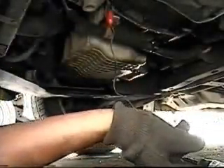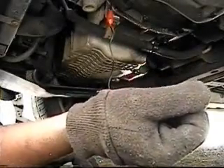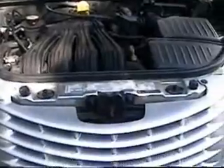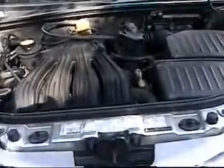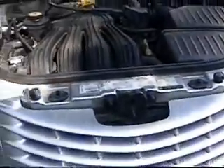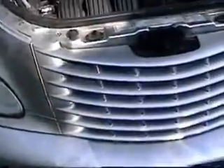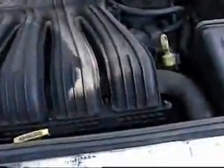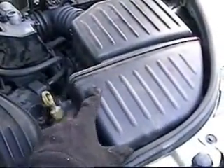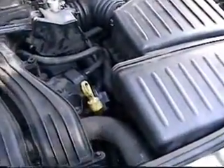I'm going to get a replacement cooling fan and see if that solves it — it should. I'm diagnosing the cooling system on this '04 PT Cruiser. There's a problem with the cooling fan, so I'll need to drain part of the radiator fluid, remove the battery tray, and work from there to access the cooling fan.